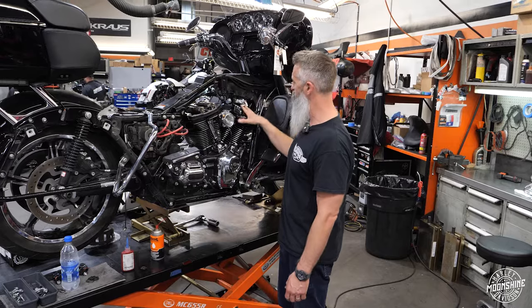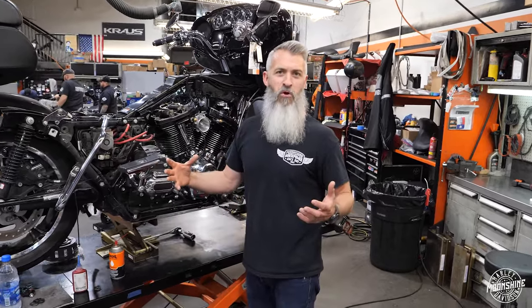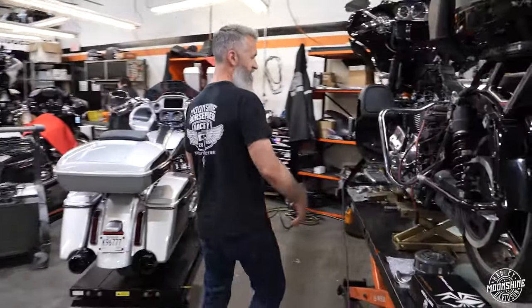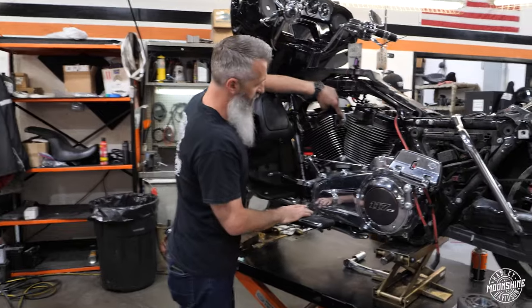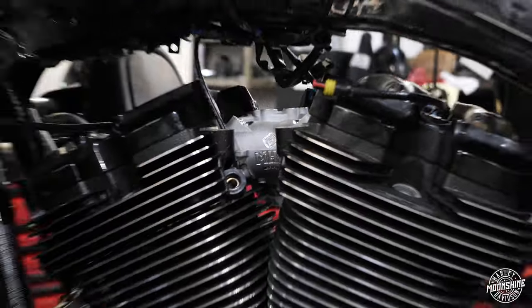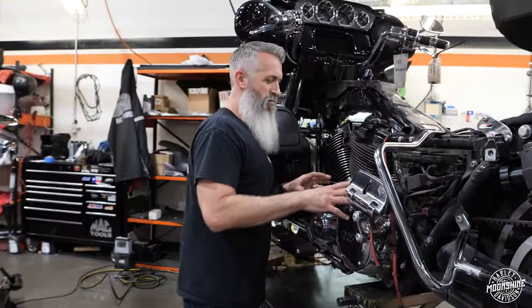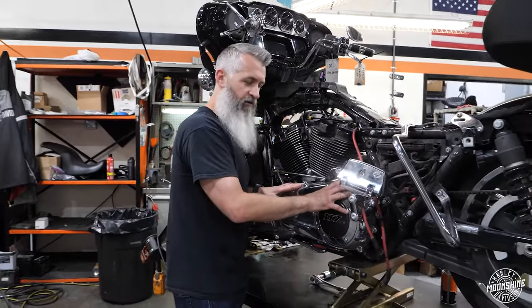When we do that much more to the engine, we increase it by over 20 horsepower, we gotta take the primary and upgrade it. So on the other side of this bike, we got the parts laid out. Sid will get to that next after he buttons up the engine, but check it out. Here's our manifold right here. The MHP Moonshine Horsepower 66 millimeter ported intake manifold. Now the primary, it might be able to hold some of it, but not all of it when you're really getting into the power of this engine setup.